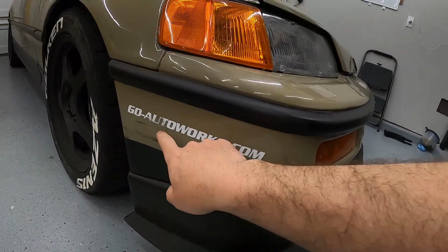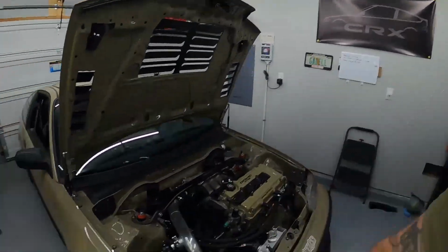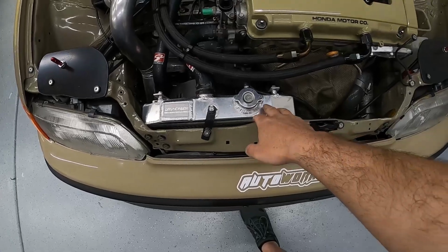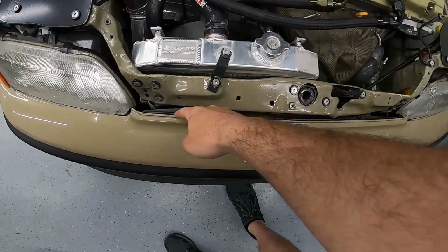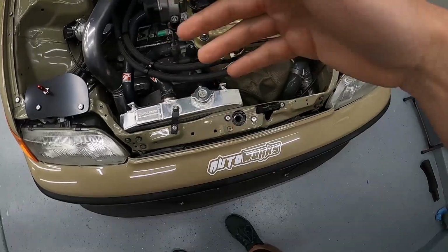I'm just now noticing this, we took out a cone a little earlier and you can see some marks on that. So really happy with the upgrade. And again, I don't want to swap to a full-size radiator, because if I did, I got to remove the T-bar, and this would be gone. I'd throw like a Scirocco radiator or something here, but the intercooler is basically right here. So I would have to push the intercooler forward again, which means I got to cut the other bumper, redo some intercooler piping, stuff I don't want to do again, because I'm really happy with how this setup is going. Worst case, I'll end up cutting the front of the hood a little bit to allow air flow to the radiator or something. But that's going to wrap this video up.